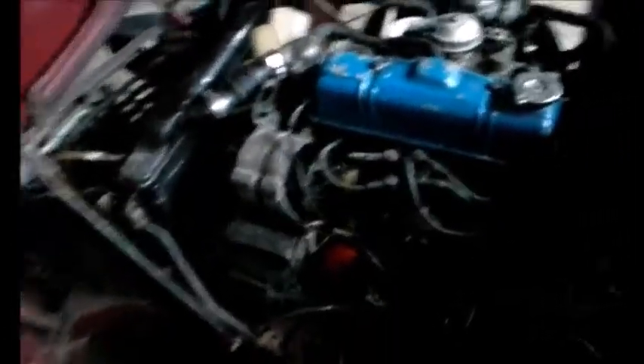So I was like, okay, I'll just put the XR700 in and everything will be good, right? Wrong. It turns out the XR700 ignition was no good — that's the reason I was not getting spark.